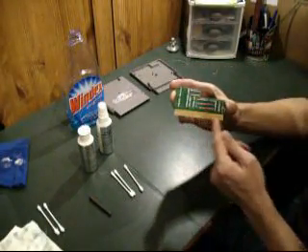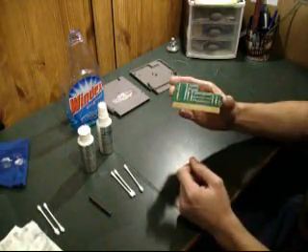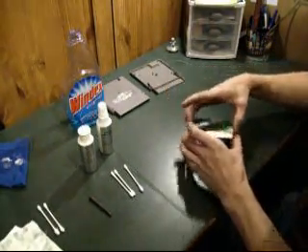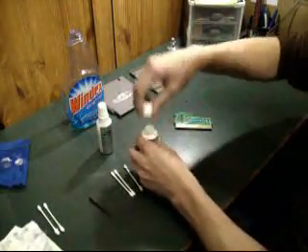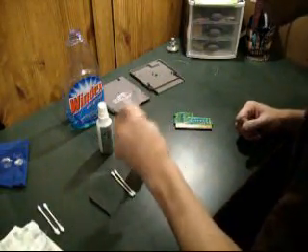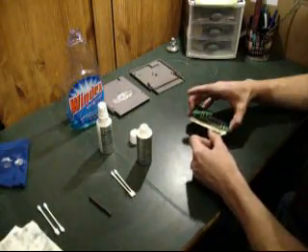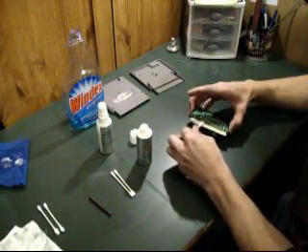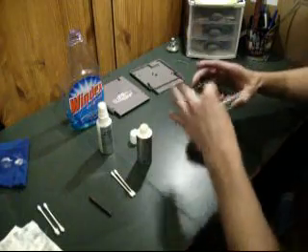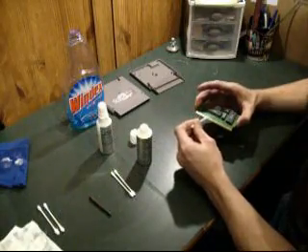These are your contacts here. If these are dirty, this is what causes some of that blinking and whatnot, causing the games not to work. These ones look pretty clean, but we're going to give them a clean anyway, just to be sure. You're going to take your cleaning paste — or if you're using rubbing alcohol or whatever — just take whatever you're using and rub it onto the gold contacts. Make sure that you cover all the gold. If you are using rubbing alcohol or a copper cleaner, you'll want to make sure that you continue to clean it until you get all the black corrosive material off of the contacts.